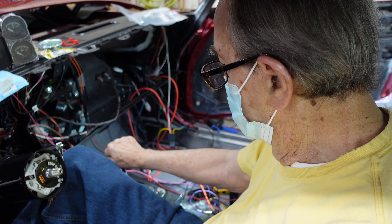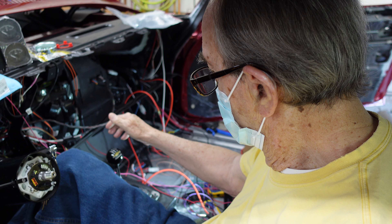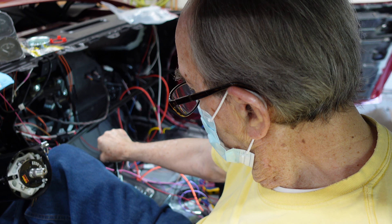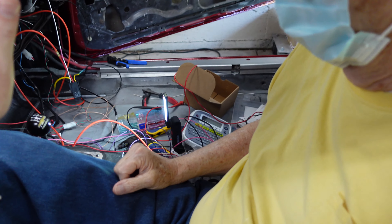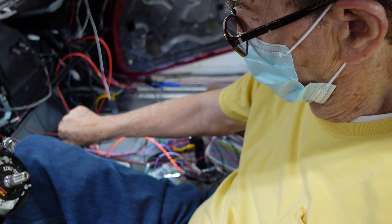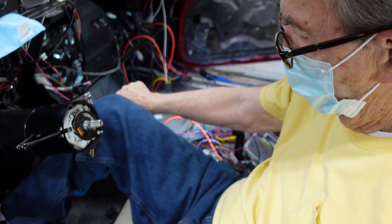Fifth and sixth. Try and mash it all the way to the right — you'll feel the spring. No, all the way to the right, not up. Just right. Feel that spring there. Just leave it there, and then try and push it straight that way. Yep, push hard. Feel it? Yeah, okay. So, that's with the reverse lockout engaged.